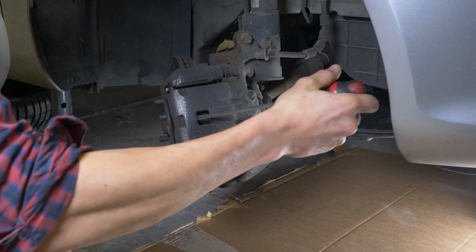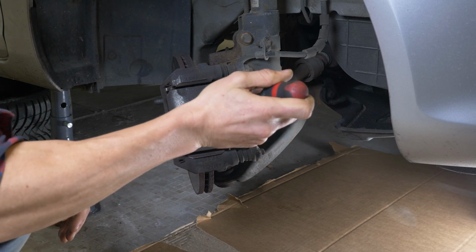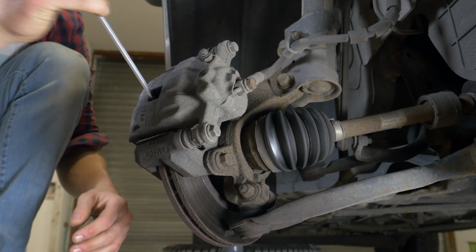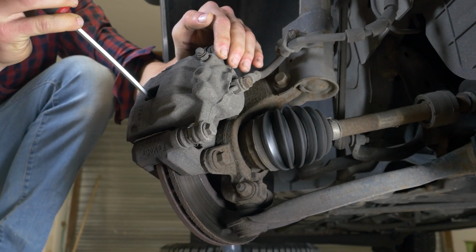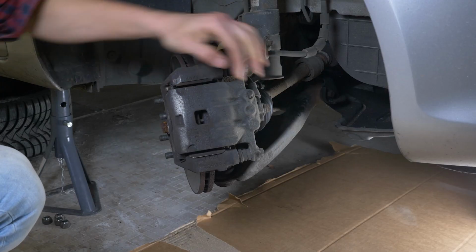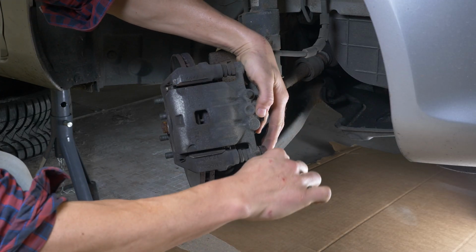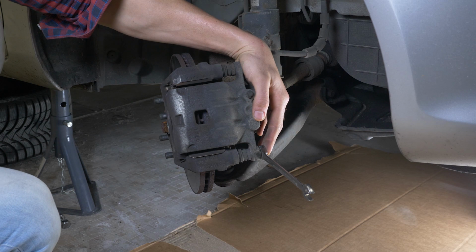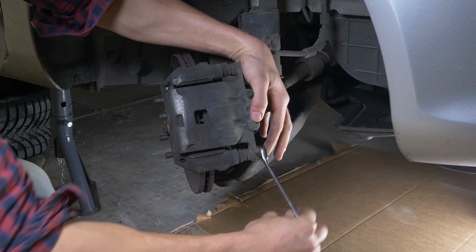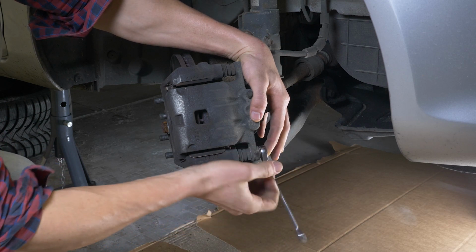Insert a flathead screwdriver to the outer extremity of the oblong hole located on the front of the brake caliper. Lift it off using the screwdriver as a lever by pulling it towards you. This will then push the piston in. Using a 12mm spanner, unscrew the lower caliper mounting bolt. Sometimes you have to stop the lock nut from turning by holding it with your fingers.